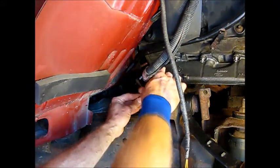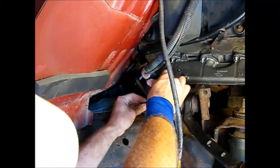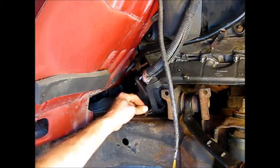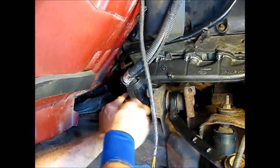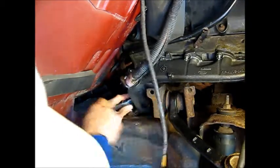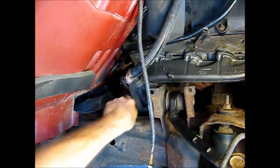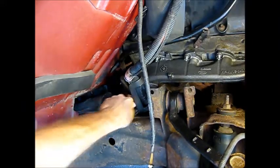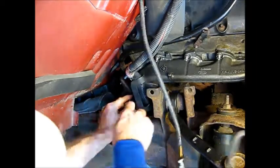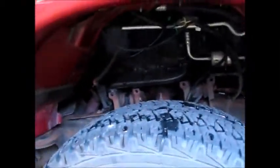Time to remount the wiring harness. Make sure you clean the bolt up — I'm going to go over it with a brush. I put a little never-seize on here too — I have a little nickel never-seize — so heaven forbid I have to do this thing again, we can get it off. Let's put that fastener on with a 10mm. I also brushed off the contact surface on here. This is used for a ground — I believe the ground from the starter might go here — so it's got to be nice, tight, and clean. Torque it down tight, but not too tight.